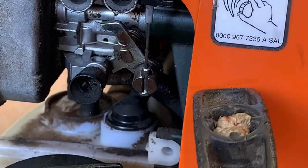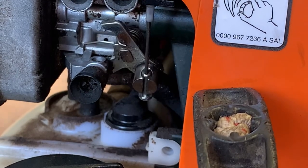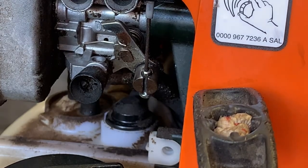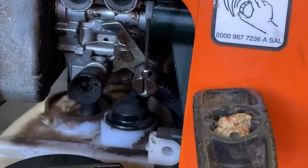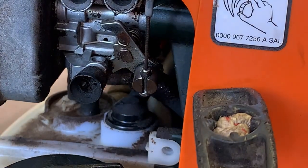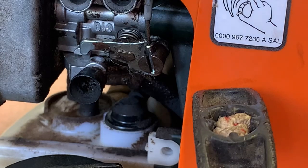We're almost there — I need to adjust it just a little more. As you can tell, when we squeeze the throttle we're still not at wide open throttle, so we're going to turn it just another turn and recheck. Almost wide open throttle — going another half a turn. And there we are, that is wide open throttle right there.